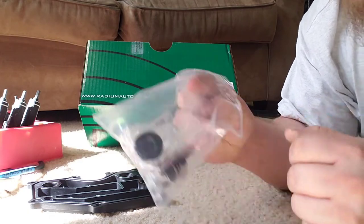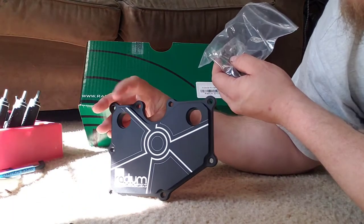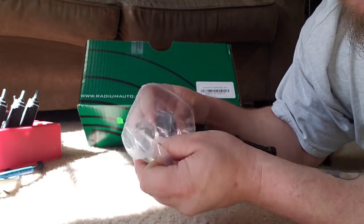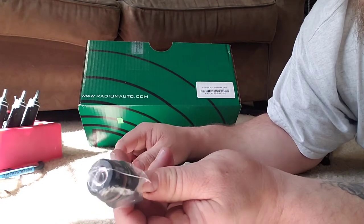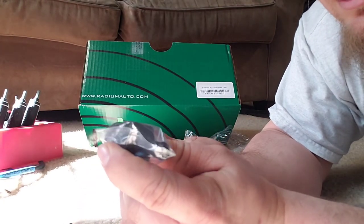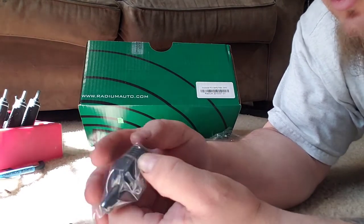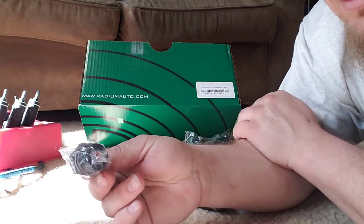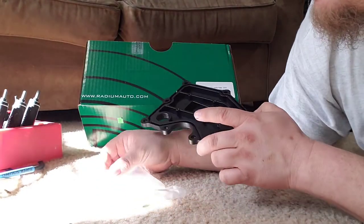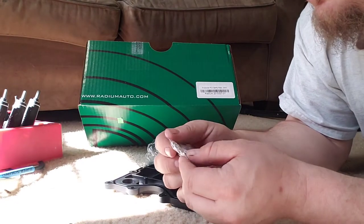Digging deeper into the bag: there's the plug for the side — we're not going to use this side — and then there's the PCV valve. It's essentially just a check valve. Positive pressure on this side gets expelled through the tube into your catch can, or back into your intake manifold if you don't have a catch can. That's why catch cans are important, especially with direct injection, because there's no port injection and no fuel to clean your intake valves. Any oil and dirt that gets on there is going to stay there.